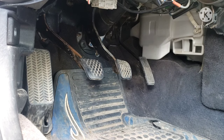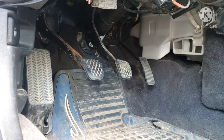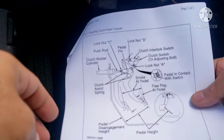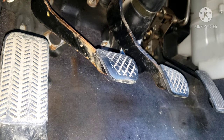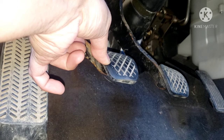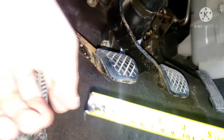The main thing is we're gonna adjust the lock nut — the nut on the master cylinder rod going to the clutch pedal. That's the nut we're gonna adjust to see if we can reduce the high engagement problem. That's nut C on the diagram. The first test we're gonna do is the free play — the distance of how it sits right now.